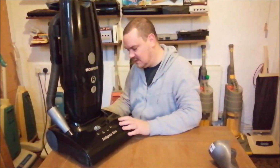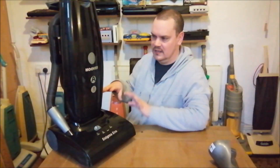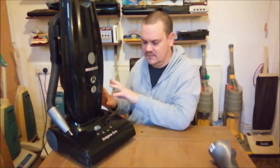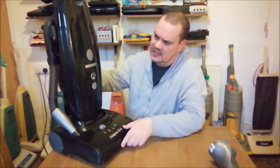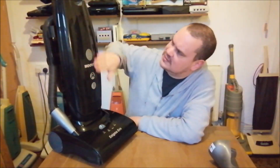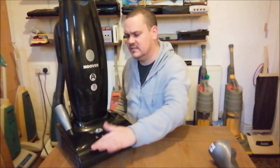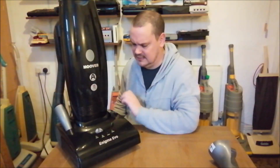Anyway, I'm not going to take this away and do an in-use video of it, because I don't think there's much point, because you're going to see it again soon, as I say, I have a plan for it. I want to give this machine a fighting chance in the plan that I've got for it, so I'm going to have to give it a service. I'm going to have to clean the filters. I'll probably put a new belt on it. The brush roll's got hair and stuff on it, so that needs to be cleaned off. I think I'll give it a polish as well, see if I can get rid of these marks on the front. We'll give it a fighting chance. I think it's going to lose the fight, but we will see.